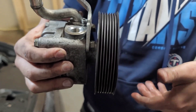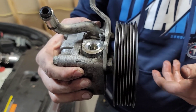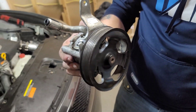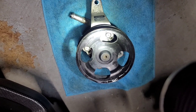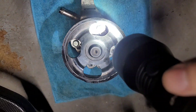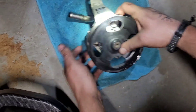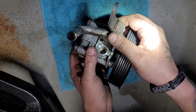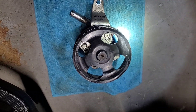You can see that is the reason we're replacing the power steering pump — see that wobble? That is pretty bad, and there's a lot of slack in that pulley. The power steering pump we bought is a brand new Duralast pump from AutoZone. With that pump you have to reuse your existing bracket, which is removed by two bolts and a star bit screw, and we need to reuse the pickup tube.